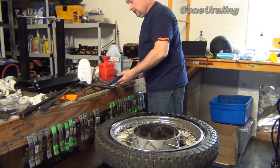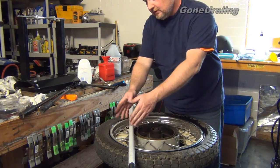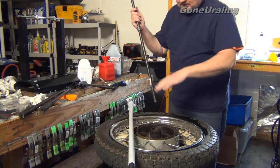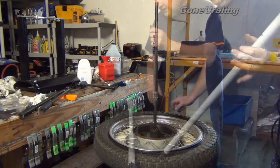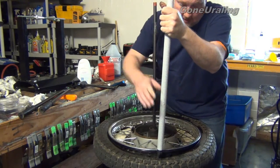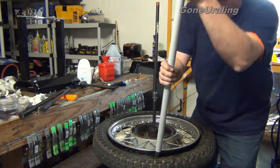I did spring for a treat. I did half of these with the spoons and that's work — I use three spoons and you just work your way around two, three, four inches at a time until you pop the thing off. So I ordered the Nomar bar. My table isn't quite set up for it so I came up with this to use as a center bar. I do have a pocket under here in the table to allow the center bar to engage it. I found if you push down on the back to give it a little gap, feed this bar in — it's a little bit of a trick to grab it, but it will grab it. Popped off there, there we go.